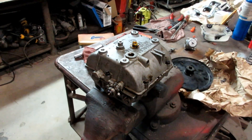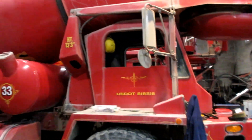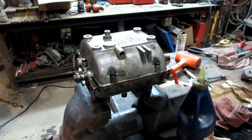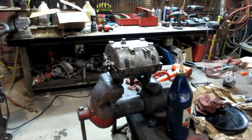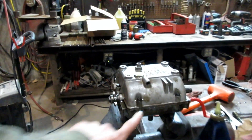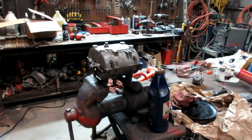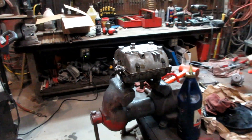I might try and get a quart of gear oil in there - I think that'll fill it up enough. I ended up putting not quite a quart, probably about three quarters of a quart in there. The level is probably right about here, which is probably more than I need, but if it weeps out, it'll weep out until it won't weep anymore and I'll just leave it like that. I could also drain some out through the drain plug, or pop that cap back out and dribble some out. I really only need to fill it up to about here, but three quarters of a quart brings it right up to the split of the case.